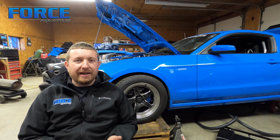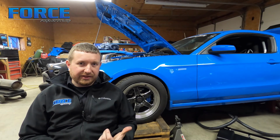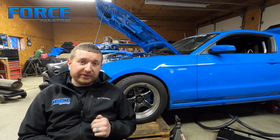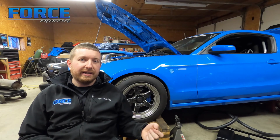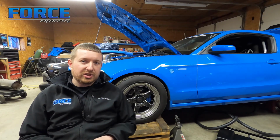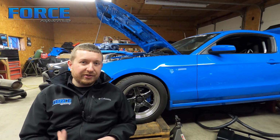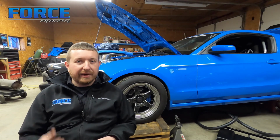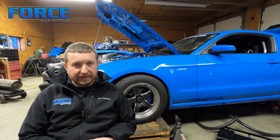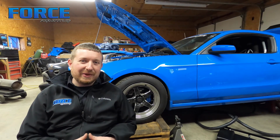So currently, with the stock ECU deal, I data log with the N gauge, and then I program stuff with HP Tuners. And then I have a Boost Leash CO2 boost control on the car, so the boost control is separate, the engine management separate, and then if we do the nitrous switch to run the transmission, that control is also separate. So multiple boxes, and then the 2-step on its own right now currently. Obviously when I go to the Haltech, that'll go away, the bump box will be gone, everything will be controlled by one unit, and that is just such a more user-friendly situation for sure.